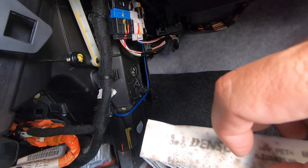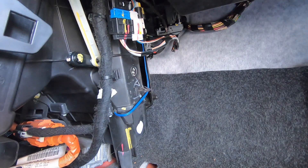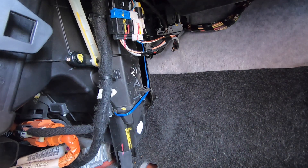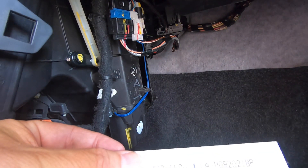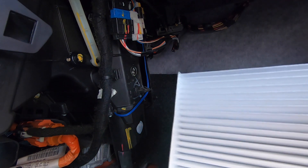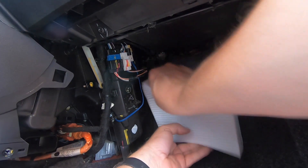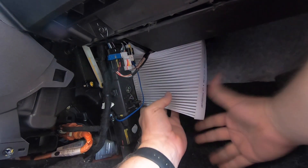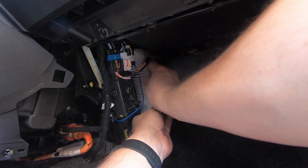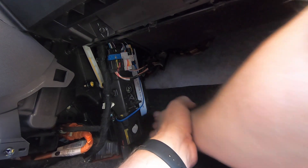Don't be like me — I had to check my video to see which direction the airflow arrow was pointing. The airflow arrow points towards the passenger compartment. So on the new air filter, line it up so that the airflow is pointing into the cabin. Based on how it came out, the slats are going to be horizontal. Get it in here, get these cables up out of the way, and in goes the new air filter. That new cabin air filter is installed.